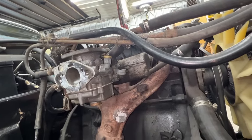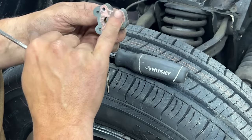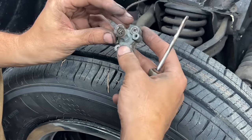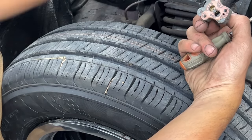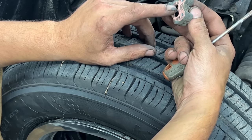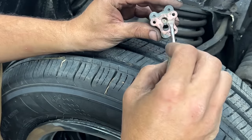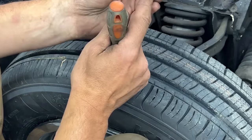The throttle bypass is out. It has a new gasket — I think the whole carburetor has been rebuilt, all the gaskets look relatively new. What this does is this figure-eight piece meets two holes on the carburetor — one is before the throttle plate and the other is after the throttle plate. It bypasses the throttle plate. However, you can close it with a plunger that goes in and out.